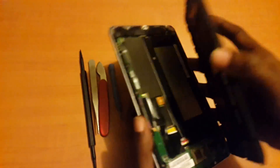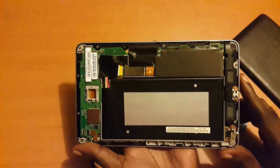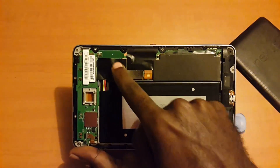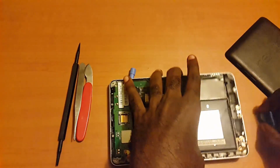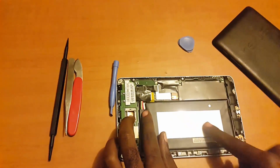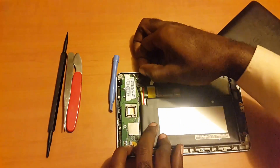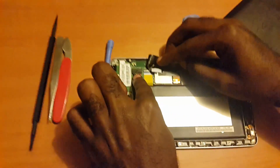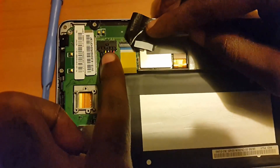I have actually pre-opened this one — I'm just demonstrating. Once you get the seams open, gently force open the device. Once you go inside, you should see something similar to what you're seeing right here. You might see some tape covering the sensitive parts of the device. The first thing I want you to do is locate the battery — you can find it here. Lift off the tape and you'll find the contact point for the battery.